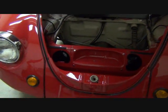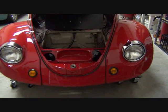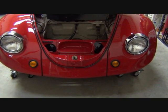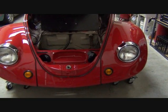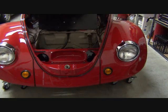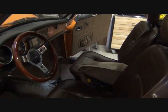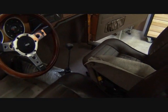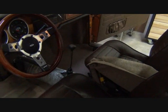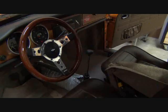Okay, so that's what's involved to prepare for removing that shift rod. Those cover plates must be removed. Our stick shift will be removed. And then that rod can go out through the front of the vehicle. And so we'll show you how we do that.